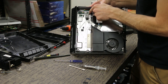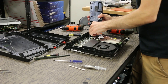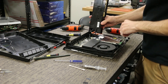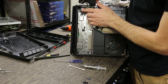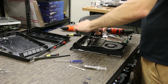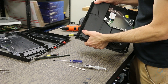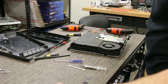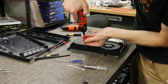Line up the optical drive connector and push it in. Then the power supply goes back in — take the cable, line it up with the connector, and push it in. Make sure these are lined up when you put it in because it's got two long pins that go into the power supply. Put it over, make sure the screw holes are semi lined up, wiggle it a little bit, push it down, and it snaps into place.